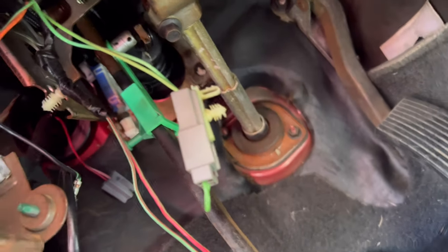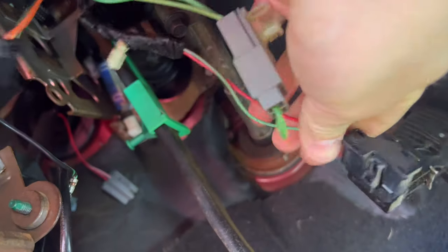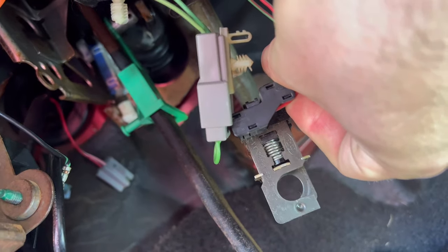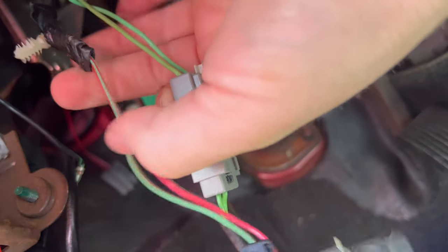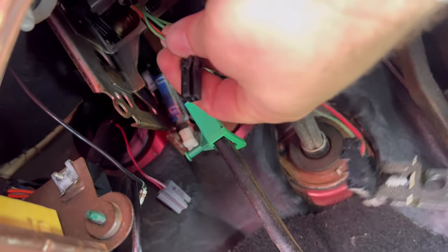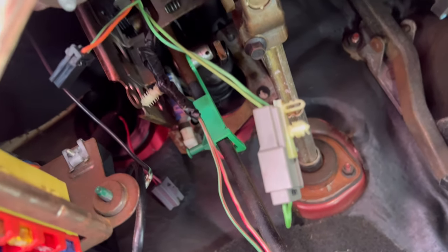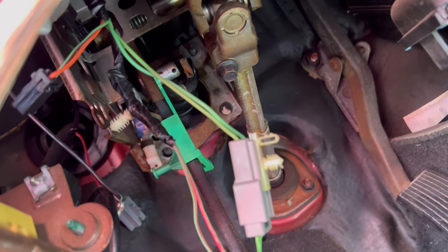So I have the harness removed. Here's that jumper I was talking about right here — this goes on the brake pedal, it's basically a brake selector type switch. And here's the actual brake light switch. So there are three plugs on this harness. Pull it away because it's going to go on to the next pedal — all this will be installed on the other pedal assembly.